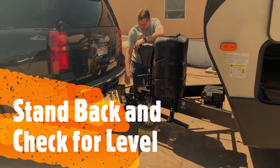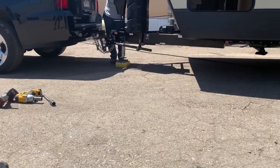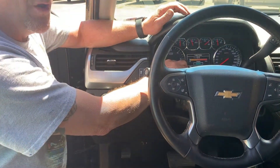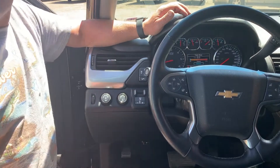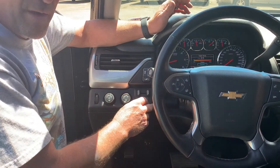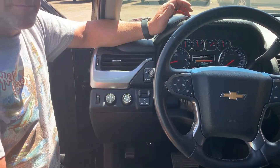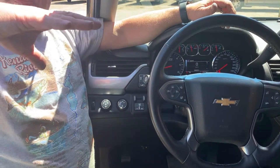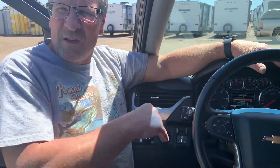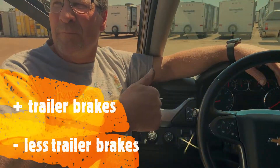You can see that all of this portion and your camper is all pretty much level. It says gain zero — that means you have no output. When you step on the brake, it is not sending anything back to the brakes. We're going to bump that up — it goes in .5 increments. I'm going to do this about 4.0 for right now. So when you get your truck and camper loaded up, everything ready to go camping, on a flat dry surface, let off on the gas and push that over. If that thing pushes you forward, you need to bump it up. If it pulls you back, you know you've got it set too high, because it's locking the brakes up back there. You want a nice, steady, gradual slowdown.